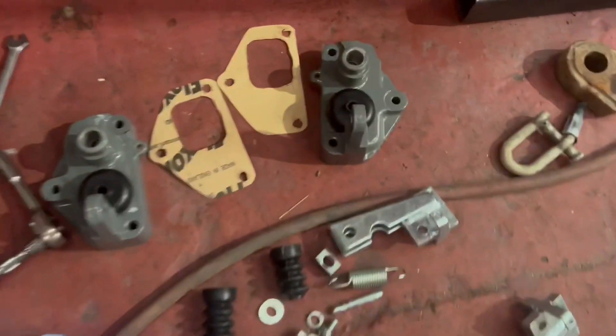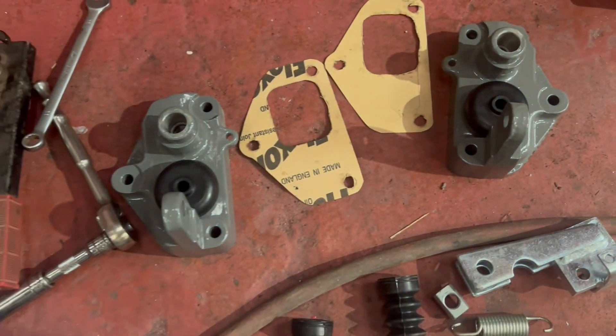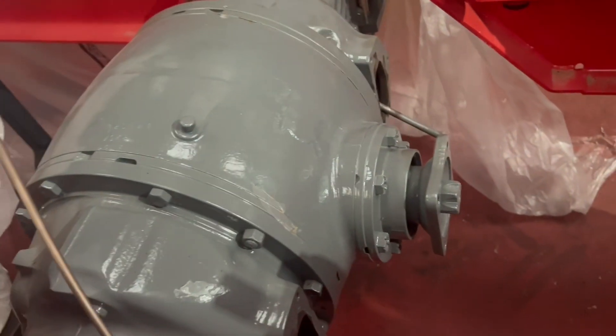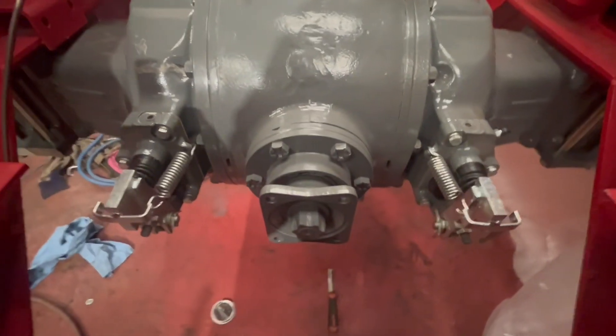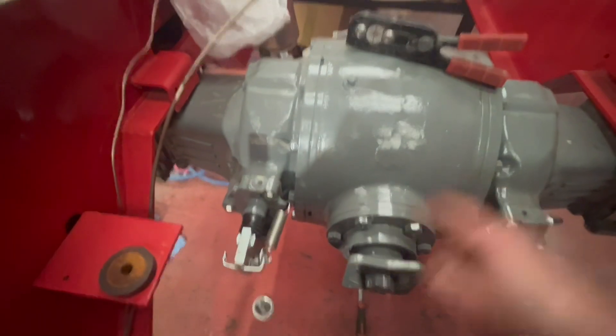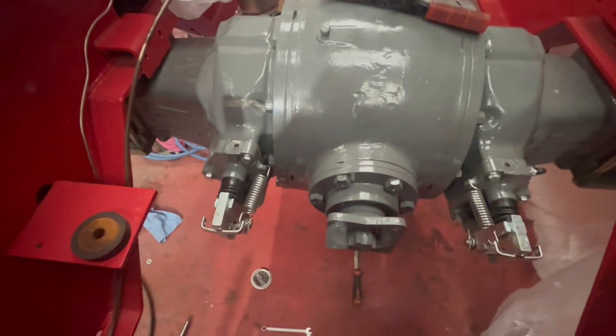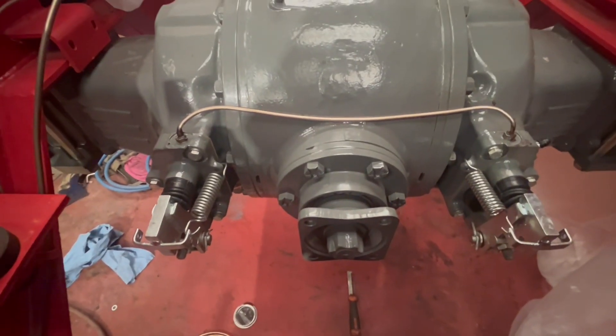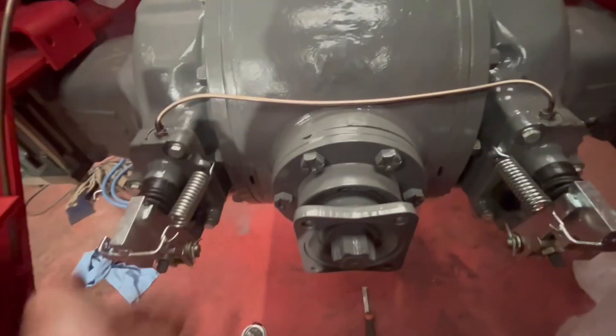While we're in the mood for doing brakes this morning, I'll do the ones on this dry brake axle — the other 1200 bits there. Gaskets cut, new rubbers because these are dry brakes — it's a different seal, it's only a dust cover. All the bolts, bits and pieces. We'll get in there and get them fitted on that. We've got these dry brake slave cylinders fitted on — springs, pins, shiny bits. So we've got some pipe here and a flaring tool, so I'll make the link pipe to go between there and there. That'll be a good show for this morning. Pleased with that — we've got that one done, and nearly this one done too with the link brake pipe made. All in, split pins, job done.